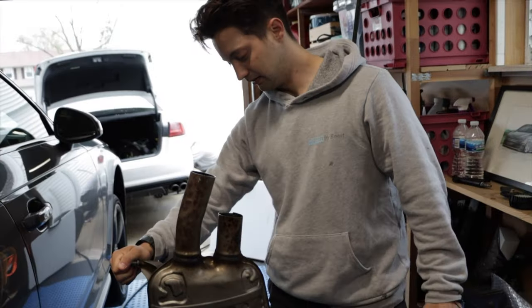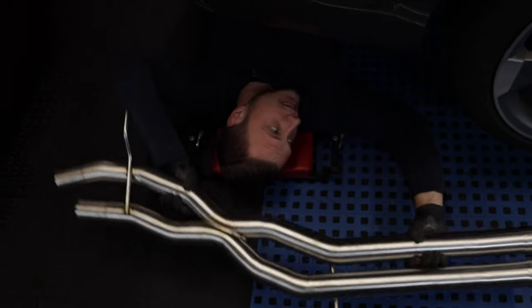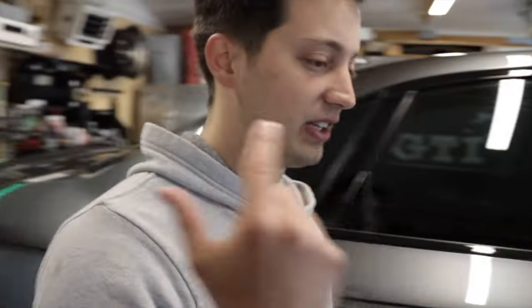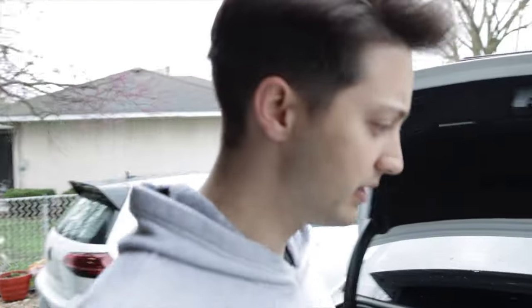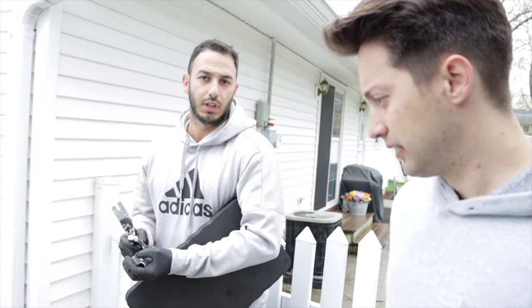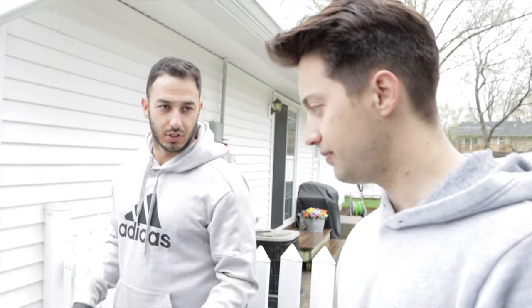The center muffler. Hey, Mike. Yes. No, not like that. No, I'm not that excited. Okay. Well, Mike's found a way. Joey brought his S6 here today. Put the lowering end links on. Is that what they're called, Joe? Yeah, they're the height sensor links. So this allows Joey to ride lower with the factory air ride setup, which is kind of cool. Or drive it lowered, right? Yeah. And it won't throw a code or anything. No, because you can do a little bit through VCDS and then before it starts throwing errors, it essentially tricks the computer.